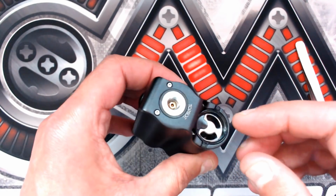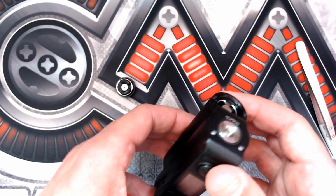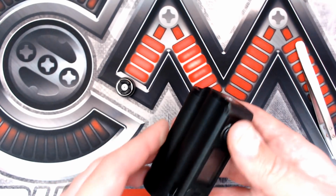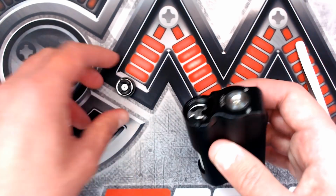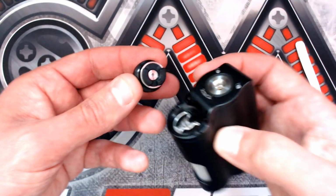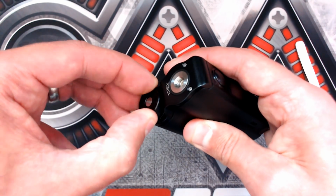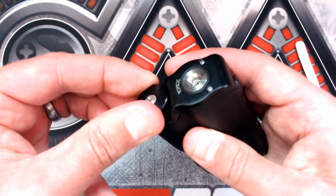But what you can do, if you want to clean the inside of this connector, you can fill up the Squonk bottle with water, and then you can just face it away from the circuit board, and give the Squonk bottle a little press, and it will clean that through here. So that's up to the user, but it will void the warranty if it should get into the circuit board. But yeah, it can be done if you should so wish. Right, so to put this cap back on, you just literally line up these two parts here with the top of the bottle, and this bit here is spring loaded, so you need to make sure that that's in the correct place. You push it down, and then you keep it held down and turn the top until it finds the threads, and then it's done up tightly like that.